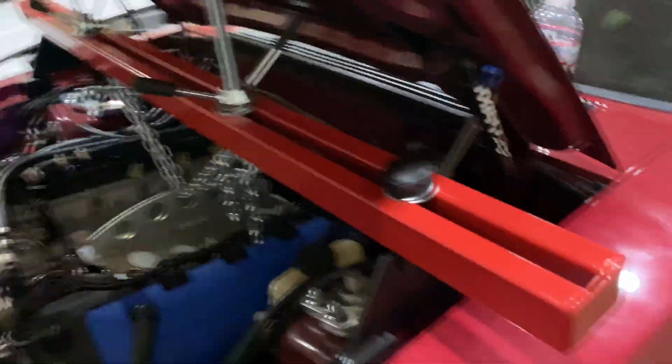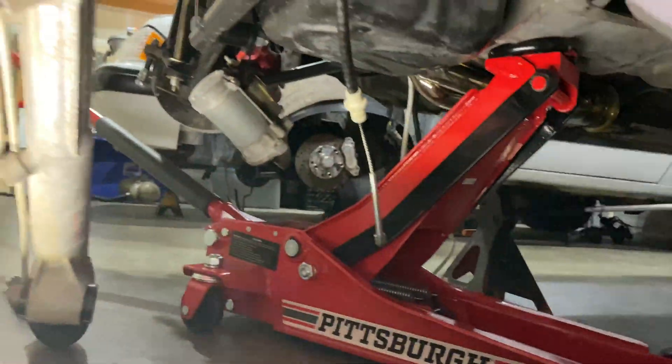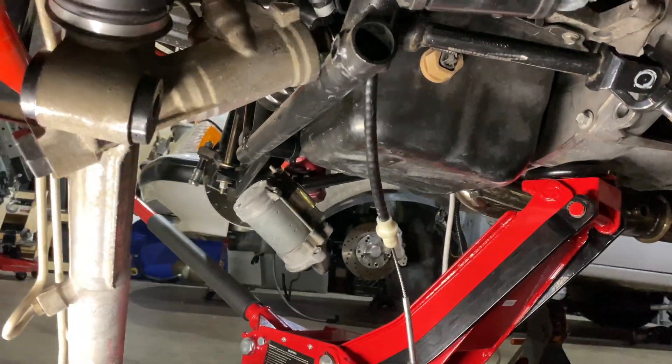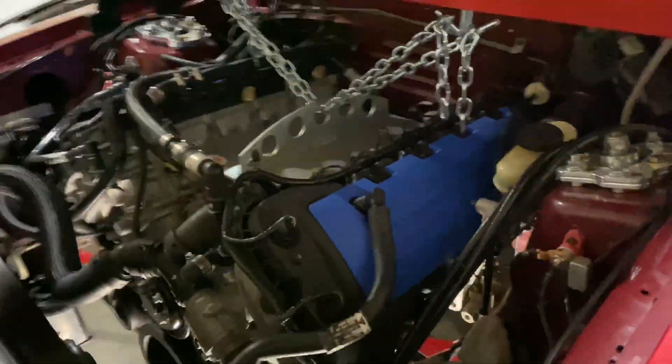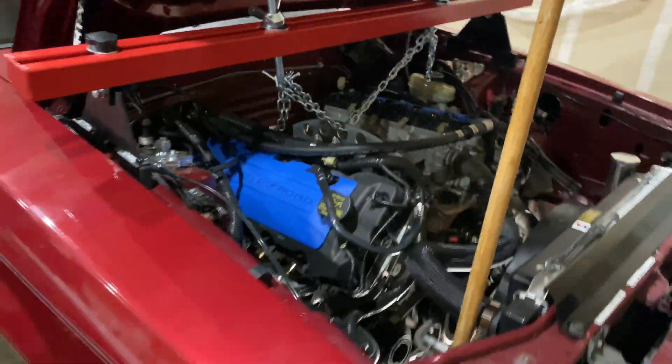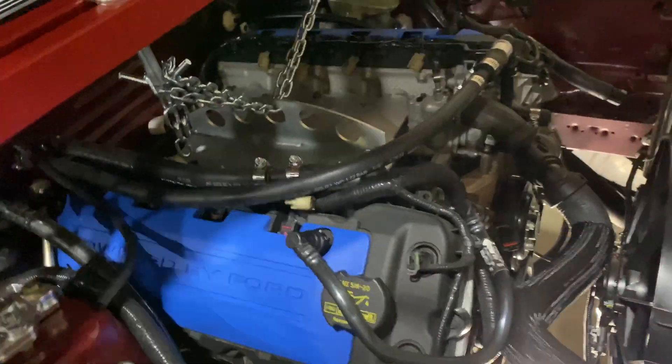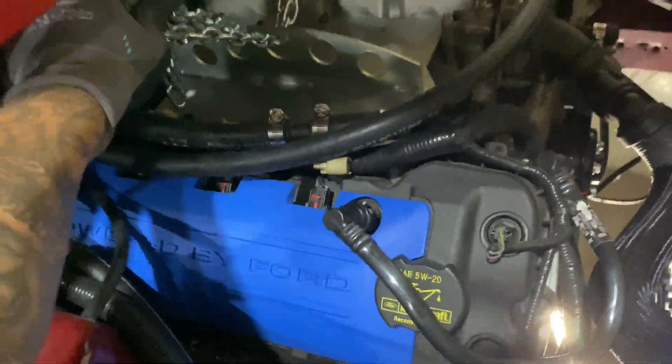Another update — been at it for a couple hours, but been kind of getting distracted. So here's where we are: I was able to get that header out, no issue. A couple nuts were just small turns. I do have the stock studs — I only use one bolt up top and one on the other side so the steering shaft doesn't hit. Took the K-member bolts out, supported the transmission with the jack just to get the pressure off the bolts, and I've got it held up. It's actually pretty safe — I don't think anything's gonna happen.